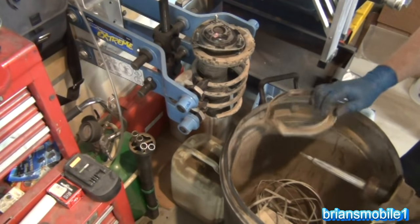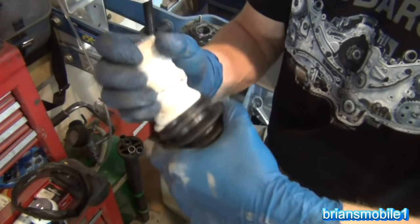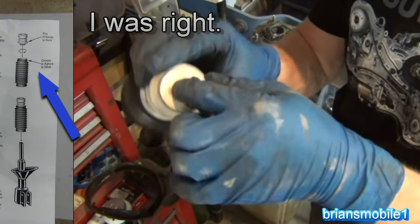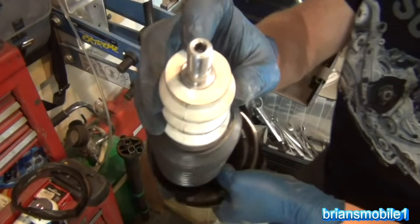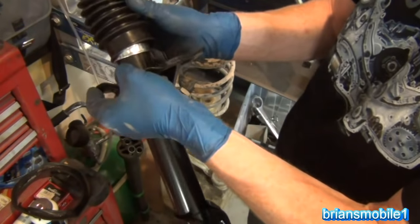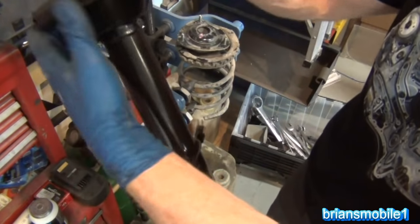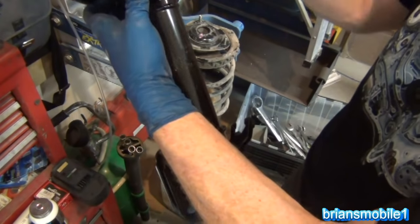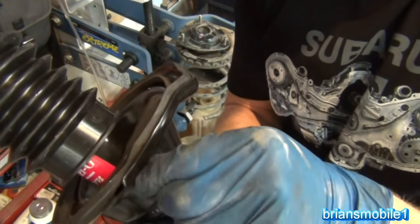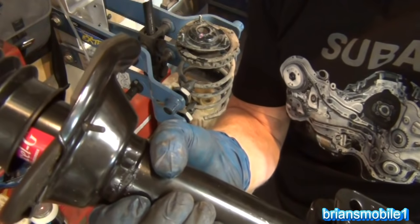Bash that on the trash can and we're going to wash that up. So here's how I'm going to do these — I'm going to do it this way because it's easier. You don't need a boot where the stopper is because it's covering it anyway. It's skinny at the top and that's typically how they go — the stopper creates a seal around the top, no dirt's getting in here, and it keeps your boot nice and low around the base. Next we take the little damper — you know you've got good struts because it's got holes to accept it. Instead of pushing down from the top you grab from the bottom and just kind of wiggle and pull on them, and it helps to seat them like that.